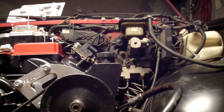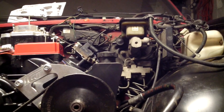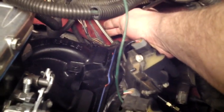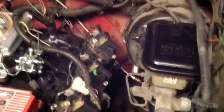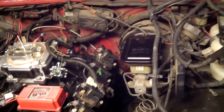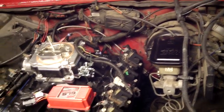Let's get this down in here. Adapting newer style quick disconnect slave to old style GM metric bubble. There she is. Bear with me — this camera is super sensitive and there is a lot of ambient noise. You can see our braided line and compression fit. She goes right underneath to the master — it's tricky, but the way I routed it keeps it away from the exhaust. Loops up and around — safe, simple, viable solution.